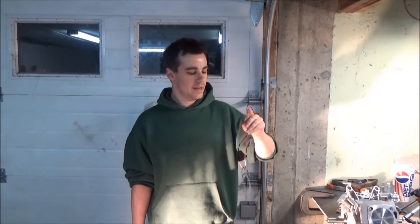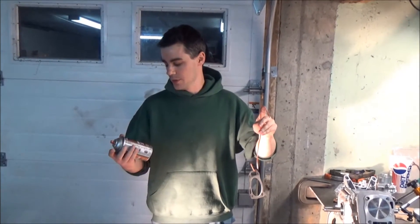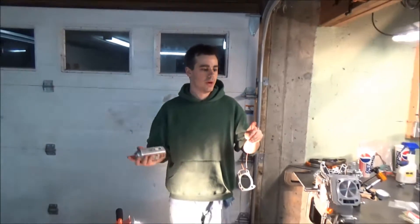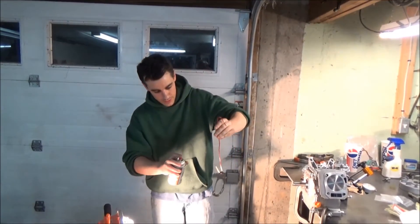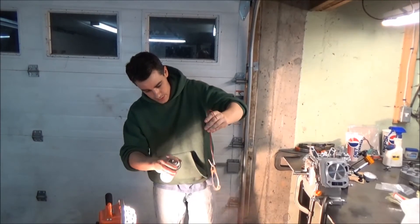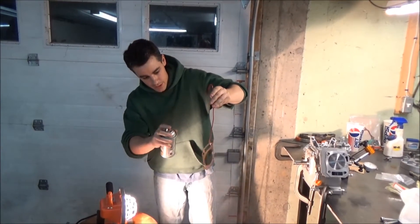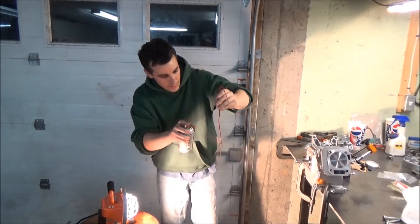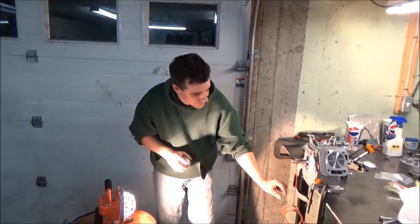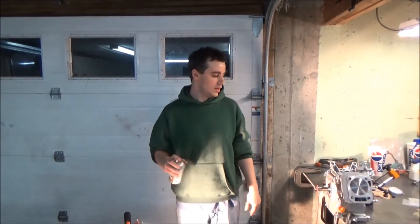We're over here with the head gasket now, about to put it on. Since it's just the thin 10-thousandths or 9-thousandths head gasket — not the ones with the fire ring — what we're going to do is spray some copper coat on here. I've done it on copper head gaskets before and it seems to work good since they don't have much give; they're not like a graphite fiber gasket. I'm going to spray it on both sides, give it about a minute or two to let it get tacky, and then install it while there's still a little bit of tack. Before I did this, everything's always oily down here so I took some rubbing alcohol and cleaned the oil off to make sure this sticks on there good.